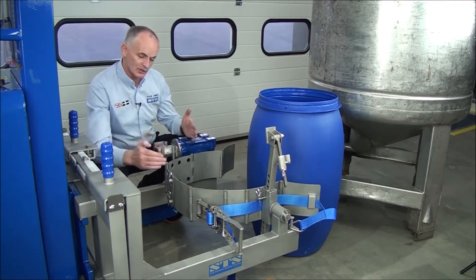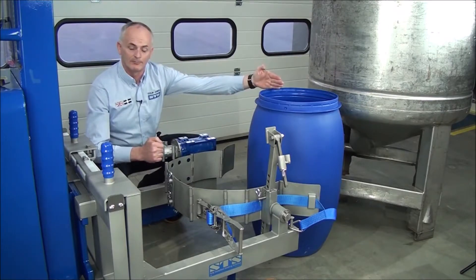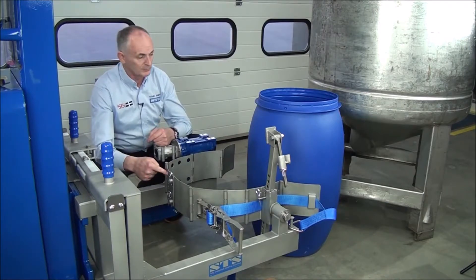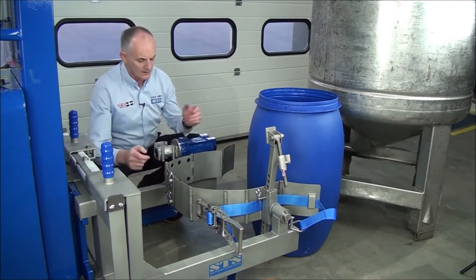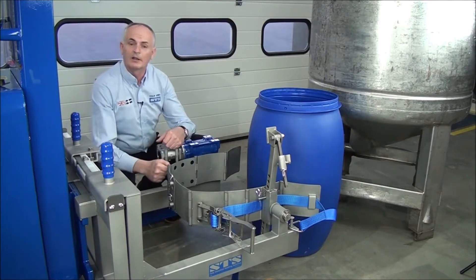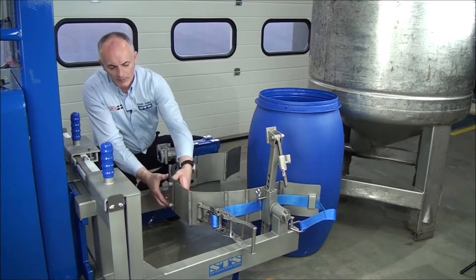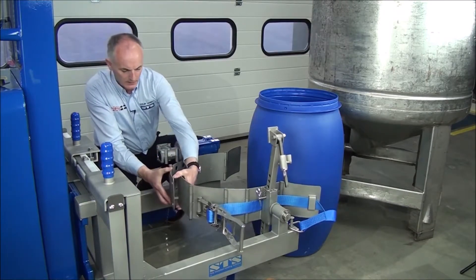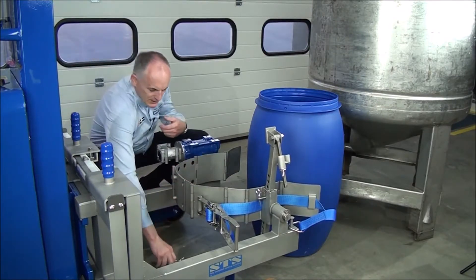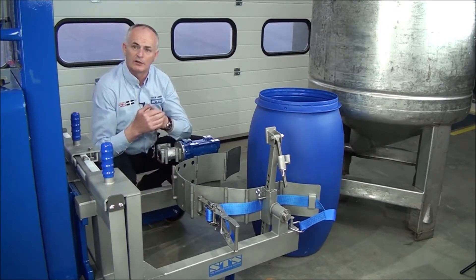Really you've just got to adjust the band so the gearbox pivot is in the middle part of the drum. So to adjust it is very easy — for this drum we want to set this in this hole because it's a smaller diameter. So push the arm in to make the gap a little bit smaller, remove these two pins, grab hold of the arm and then we just socket that in the next two pin positions there. So you can see these sticking out the back of the unit there, so we've moved it one hole position forward.